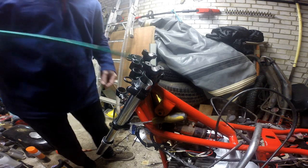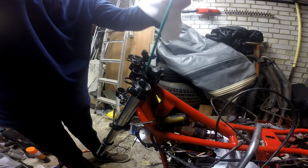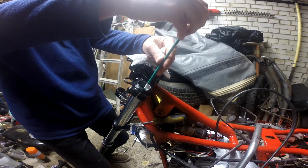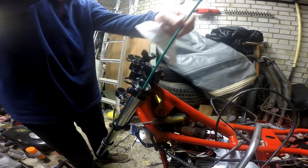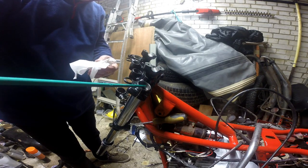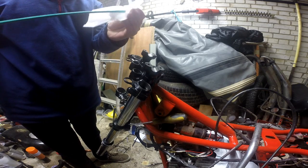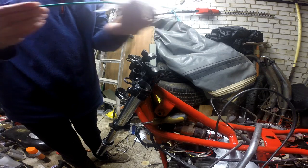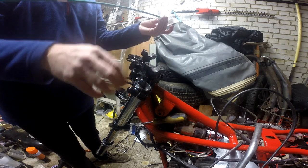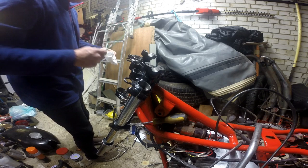I wonder if it's not gone in the dampers. So what I'm going to do is give the forks a pump and we'll see if it disappears. Right, try again. Still a bit over. But that's the amount of oil that they said to put in, so I'm going to run with that. When I get all this back together and I pump the fork, it'll probably go down. It probably hasn't primed up the bottom damper bit, so I'm running with that.